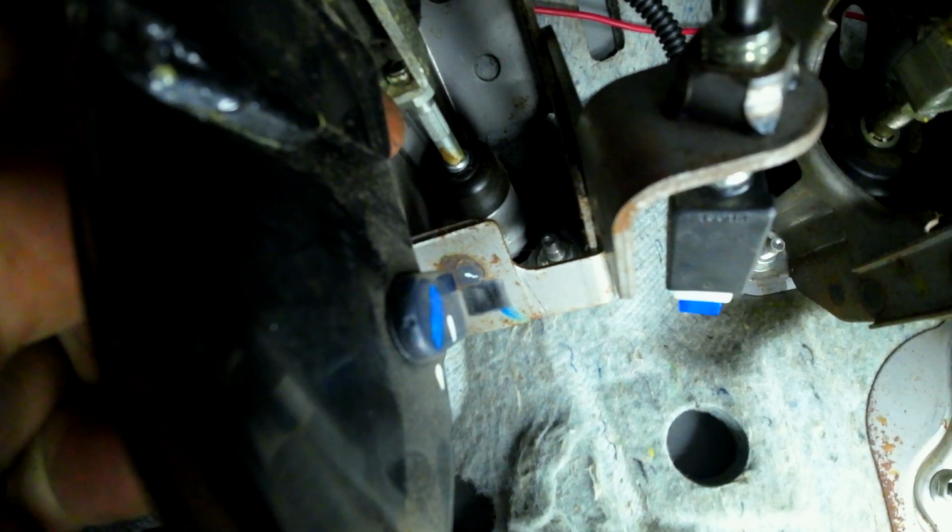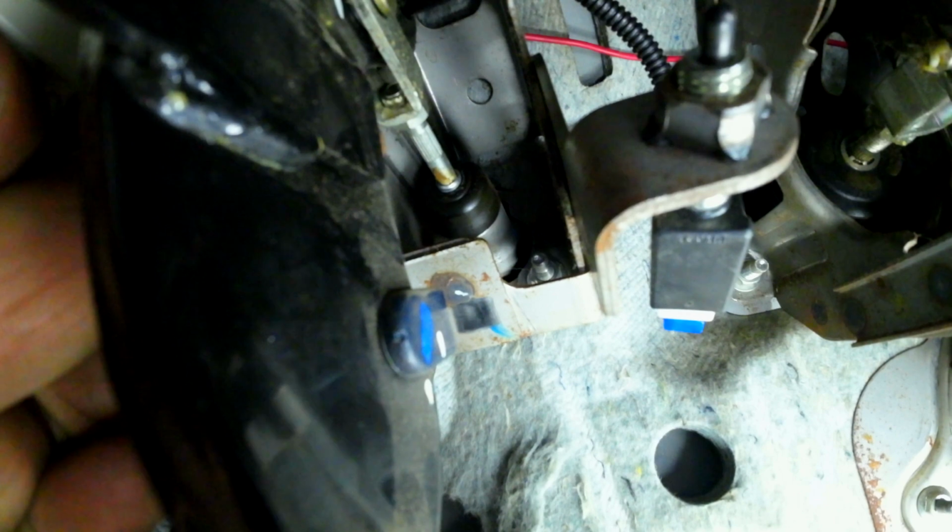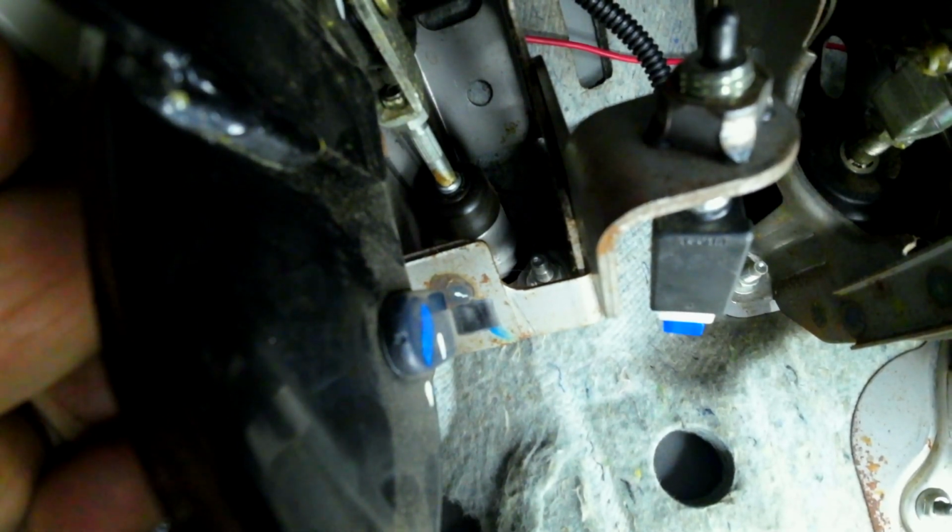And so what I need to do, because it doesn't seem like my clutch is completely disengaging when I depress the pedal, is bring it out more. Typically it's like 2 or 3 threads, I think, from the factory, and mine is almost backed all the way down. So it tells me that the Drift Games guys, maybe James, somebody at some point has adjusted this clutch for another one that came in it or was put in it.